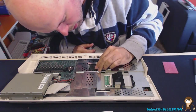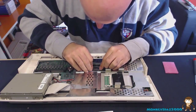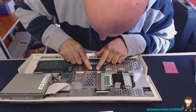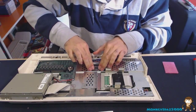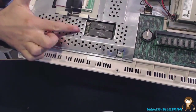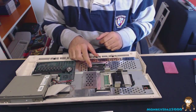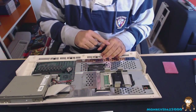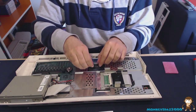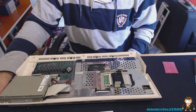Start with the back legs first and work your way in. And that's the second ROM in as well — there's a satisfying noise when they sit in place. So that's basically it: the two new Kickstart 3.1 ROMs are sitting nicely in place. ROM 391774 sits at the top in U6B, ROM 391773 sits at the bottom in U6A. If the legs are spread out, just nip them in with your fingers, seat one side first, then squeeze the rest in. Put it all back together and your Amiga 1200 is now upgraded to Kickstart 3.1 ROMs. Thanks for watching.